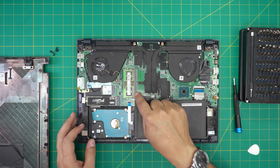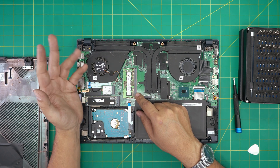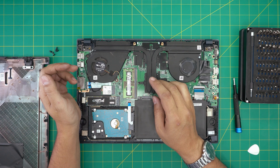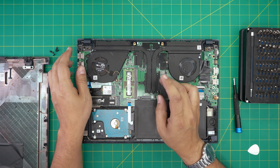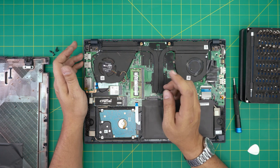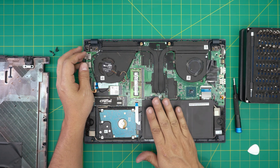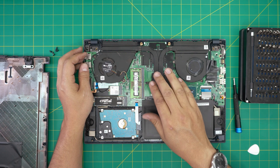Down here you'll see there is only one RAM slot. If you go to Task Manager it may show two out of two slots, but the Task Manager always reads what the BIOS is programmed for, not what you actually have physically installed.